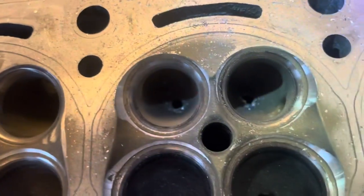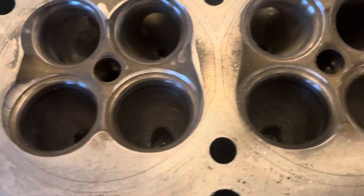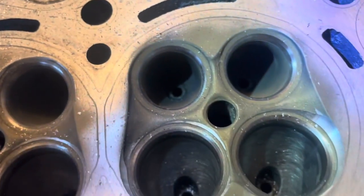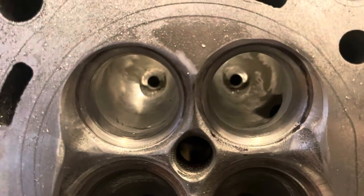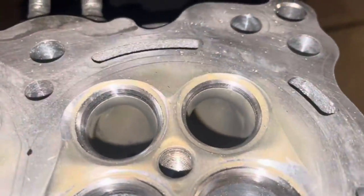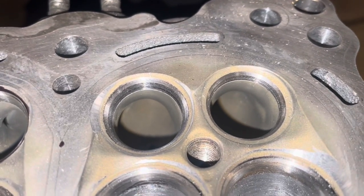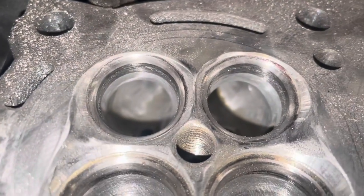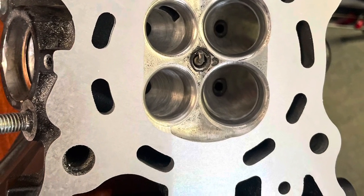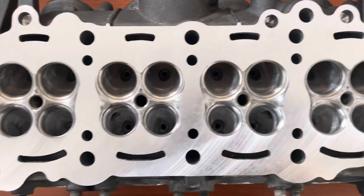Big, small — all those are still small. These were ported before. We're going even bigger on the ports, though. Massive difference in valve seats: one's cut to a 23, and the other one's cut to a 24. The port still needs to be opened up — that's the port after it's been opened up. Gigantic cut off of this bad boy.